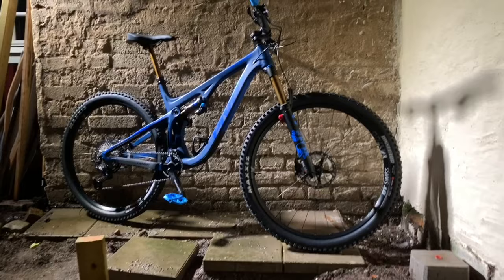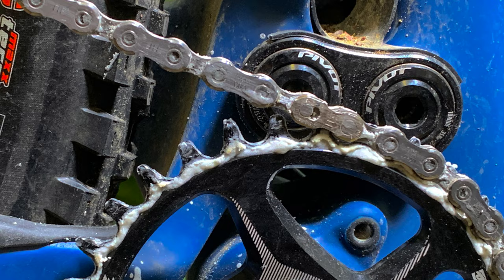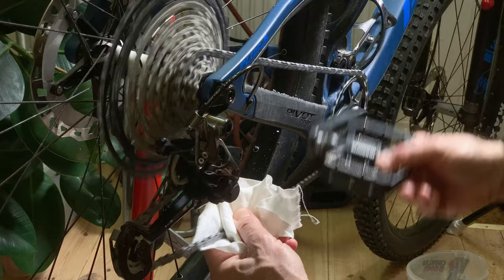The next day, it's time to activate Link Lotion, which has now hardened. The chain and chain rings are now all covered in a snowy layer of paraffin. This layer has to be smeared out on the outside of the chain and the gears, as well as — and this is very important — on the inside of the links' moving parts. We will use the superfluous hardened lotion for that purpose, partly to reduce friction even more, partly to achieve decent corrosion protection.